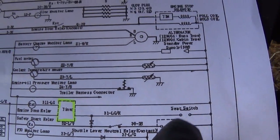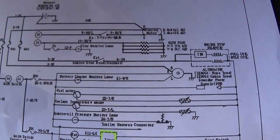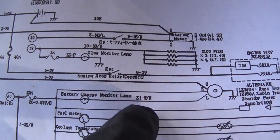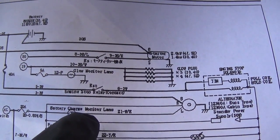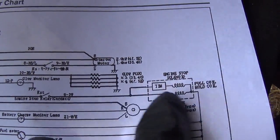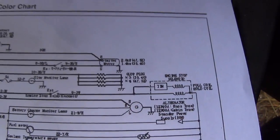But there are quite a few safety switches: the neutral switch, seat switch. There's a kind of smart box that lets the engine crank. There are two relays here — RS and RST. The RS relay goes to the starter. And then to stop the engine, when you turn the key off, that should connect this switch here and activate it. So there's a pull coil and hold coil, and from a visual inspection, it looks like it shuts off the high pressure fuel pump.